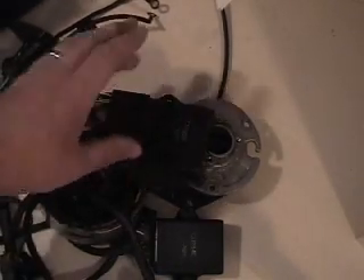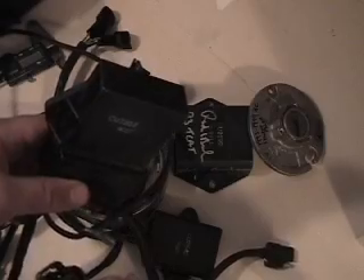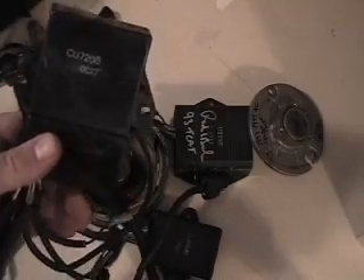Can you use a newer 2000 to 2002 ignition on an older cat? Yes, you can. But one of the major differences with the 2000 to 2002 is they have a TPS switch — your throttle position switch — and this is that little part right here. That throttle position switch needs to connect to your carburetors, and the carburetors have that throttle position switch on them. So if you're going to use a 2000 to 2002 ignition on an older model (1993 through 1999), you have to use those carburetors as well. You will also have to use that entire ignition — the stator, the stator mounting plate, the CDI box, and the flywheel.